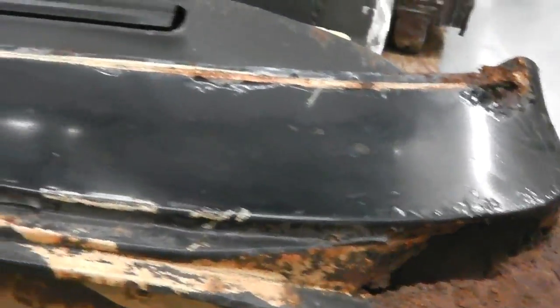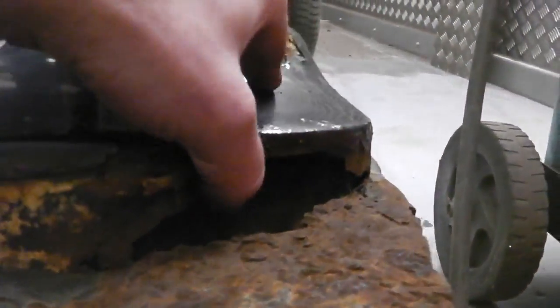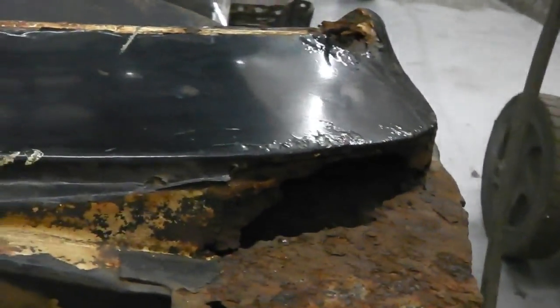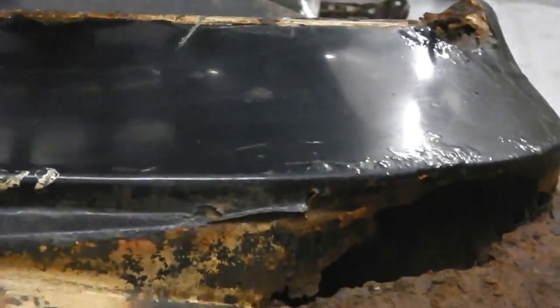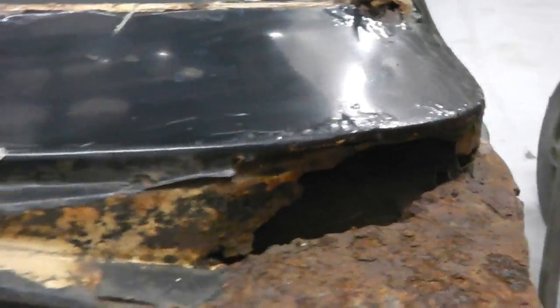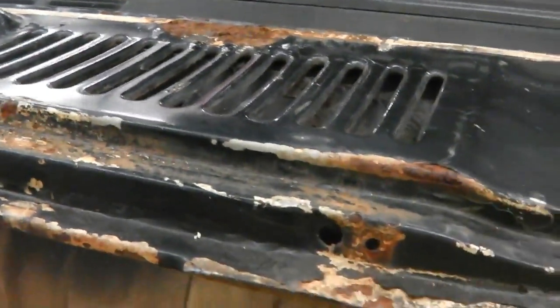And many Cortinas, no doubt, if you were to have a little look around that area, certainly if you've replaced this, you'll probably find that you've had to do a patch repair on that inner piece. I've seen people slicing these off and getting new caps, but then probably having to do localized repairs on that piece where it really counts in the middle. It never really rots, so if you're worried about your Mark III, I don't think it's a mega critical situation if that had rotted out.